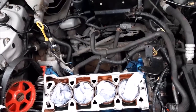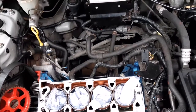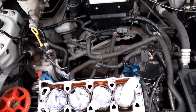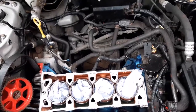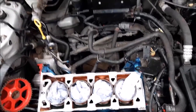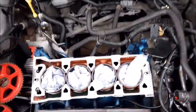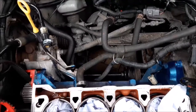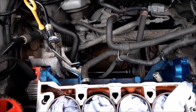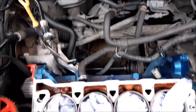We got onto them pretty soon and got it sorted out before the head gaskets were damaged, but as well as those problems being easily misdiagnosed as a head gasket, if they'd been left alone, the engine overheating and the airlocks probably would have caused a head gasket failure, and that's our experience. Even if head gaskets do go more often, it is often perhaps a problem somewhere else that's caused it. So I just thought I'd cover that in this little piece.